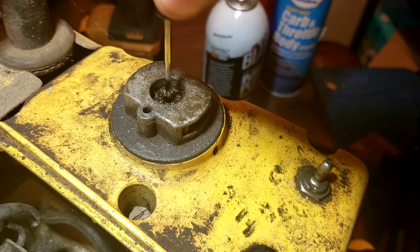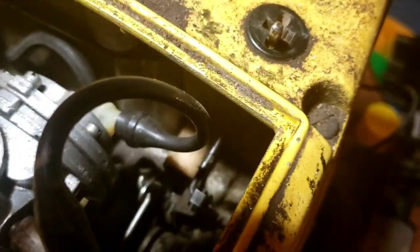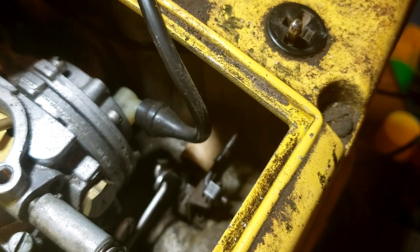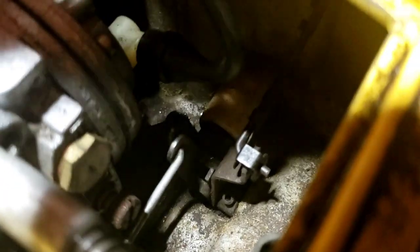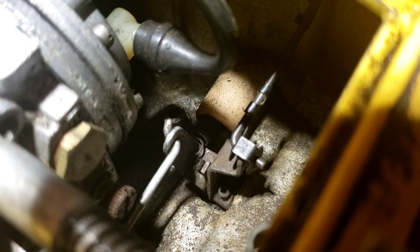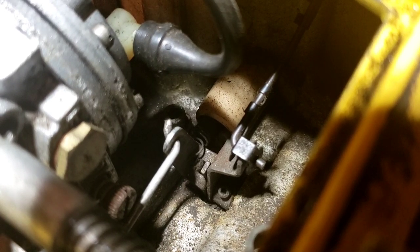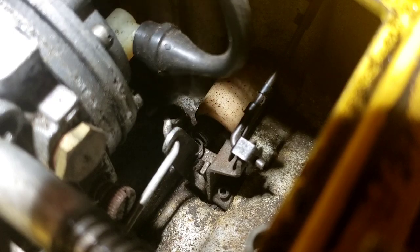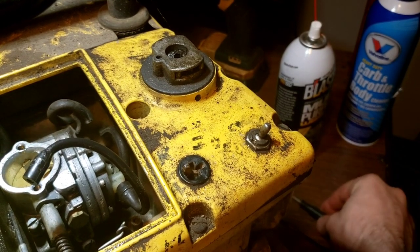PB Blaster did its wonders - it feels maxed out, and it's moving the spring. So less tension means slower engine speed, and tighter means it'll want more throttle. That is adjustable. We'll ease up the tension and leave a little bit on. So we don't need a new knob immediately - that governor screw is going to be our biggest tool for adjusting speed and amperage output.